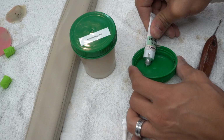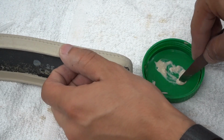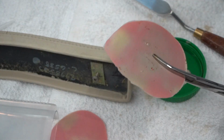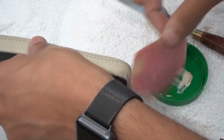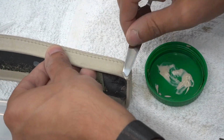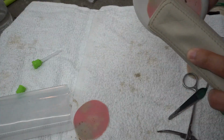So like most Meridians, the corners on the armrest show a lot of wear and tear, so we had to repair that first before paint. I'm using a heat set paste, leather filling paste, and basically it's a lot of back and forth. You put in some paste, you use this heated silicone grain pad to imprint the grain, and as it shrinks you gotta add more, so you just go back and forth a few times, and once you're happy with the texture, you can paint it and make it look like new.